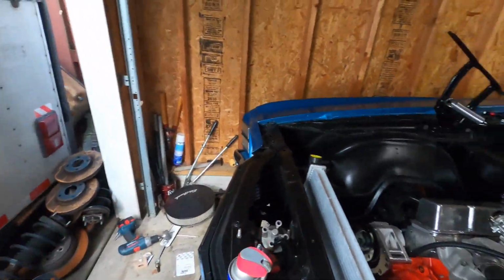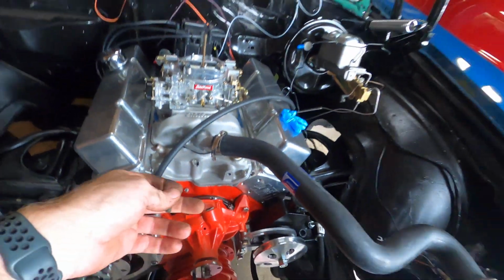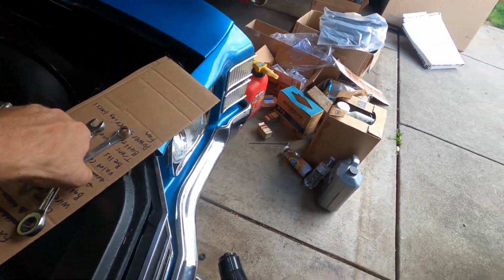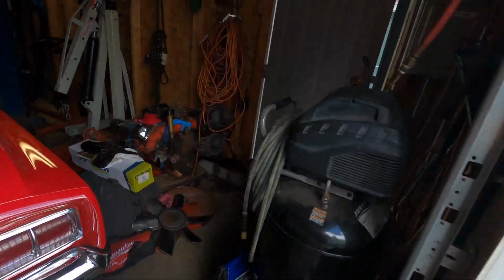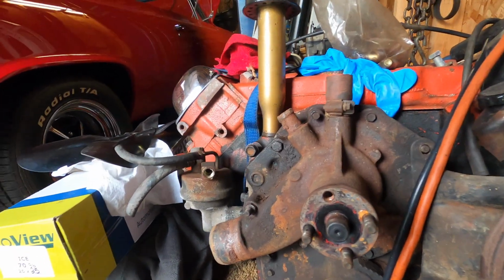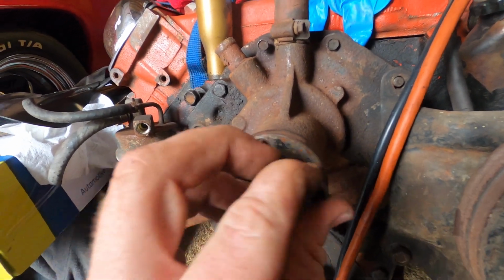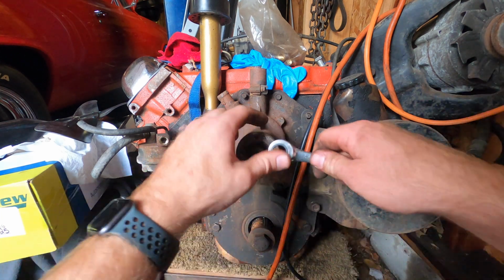And now we're trying to figure out something for this water pump because we don't have any studs. So what we've been doing, Tony got 2 of them out. I'm gonna get the rest of them out of here. Tony's got a couple spare motors here. These are like big block Oldsmobiles. So we're just taking these studs out of this. Pretty much what you do when you want to take a stud out, you just screw the nut on all the way.